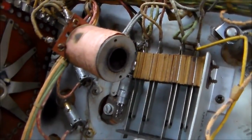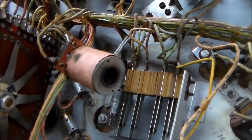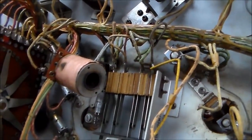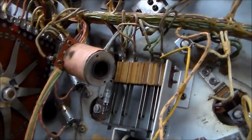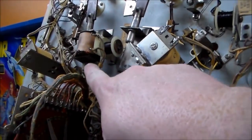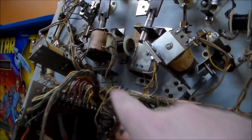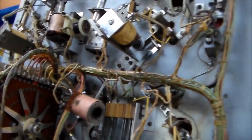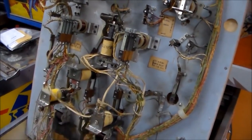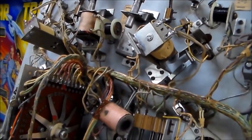The coil — people replace coils all the time, but they hardly ever go bad. A coil will go all the way bad, not partially bad usually. Sometimes you'll have a bad coil where it'll just be locked on. The way you can tell is you can just measure the resistance over the coil. If any of your coils are below about three ohms — maybe a little below that for flipper ones since they're real powerful — but if you get down to below two and a half ohms, you can measure this one and that one and see if they're similar. If this one is 0.5 ohms and that one is 3.5 ohms, this one's burnt up — it's shorted. On pinball machines you'll have the exact same coils everywhere so you can compare them. I measured these, none of them are bad.